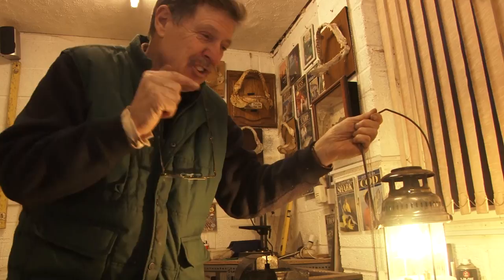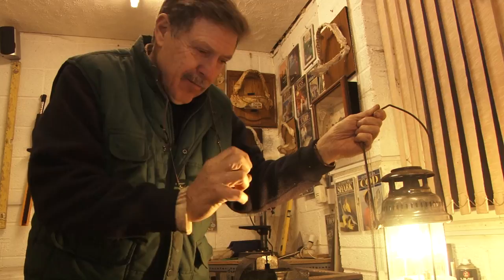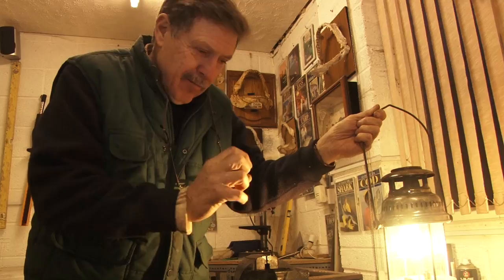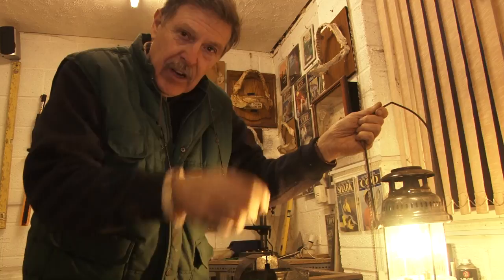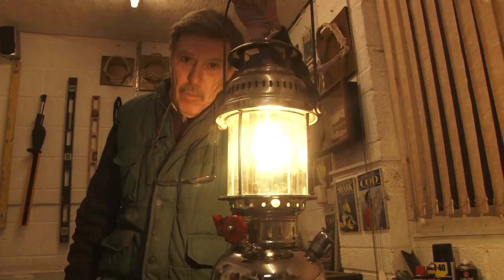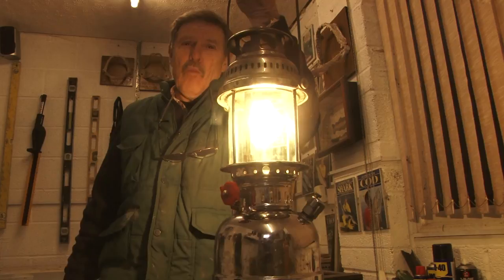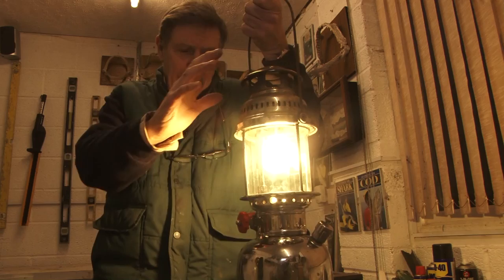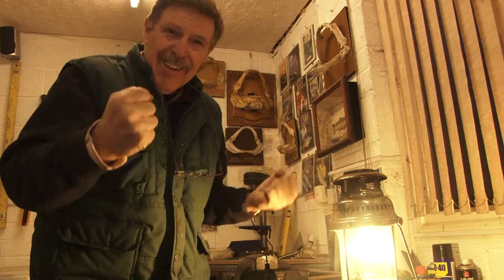Just remember: if you want to shut it down, just release the air pressure — the little nut on the side of the pressure gauge. It releases all the air, it dies down — you'll hear it die right down. But it's still very hot so be careful. Let it cool down before you put it away. I am tickled pink — that lamp is 30 years old and I haven't used it for several years. A little bit of service: replace that leather plunger, replace the leather or rubber washer on the filler, check the needle and replace if needed, clean flow of fuel over that brass center shaft with emery paper, check the mantle. And there you are — 350 candle power! They make a 500 candle power one. More than enough to light up anything outdoors, and it throws out an unbelievable amount of heat in winter.